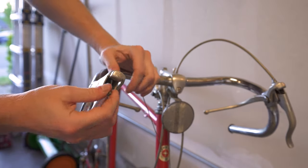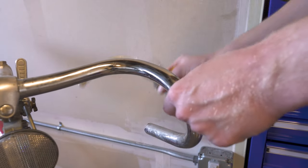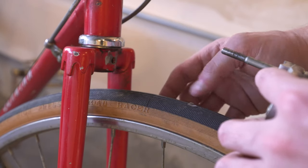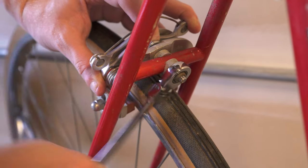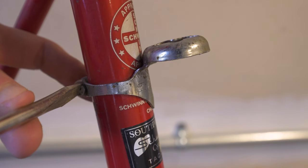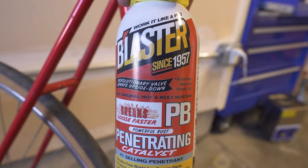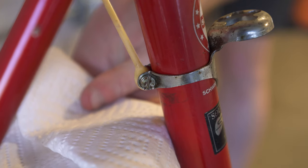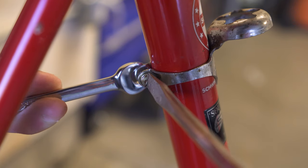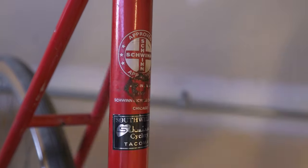I started by giving it a wash — I'm going to be washing it part by part — but it's good to give things a wash to see where things are. Disassembly of a bike like this actually goes fairly quickly. A lot of these bikes from the 70s and 80s, even if you have no bike knowledge, if you're mechanical and go slowly you can really get through them. This penetrating oil is really nice for tough bolts — let it sit 10 to 15 minutes, not just a few seconds, so it can really work in and allow the bolts to come out easily.